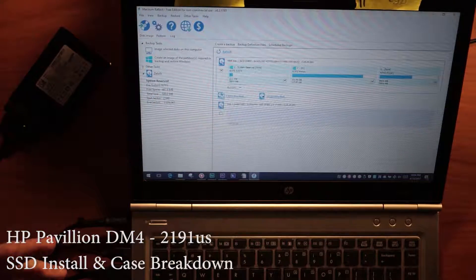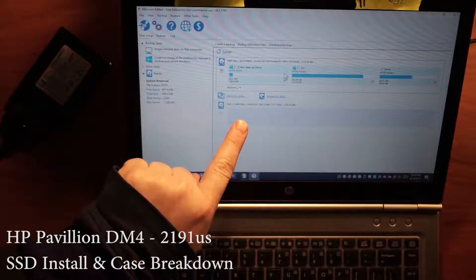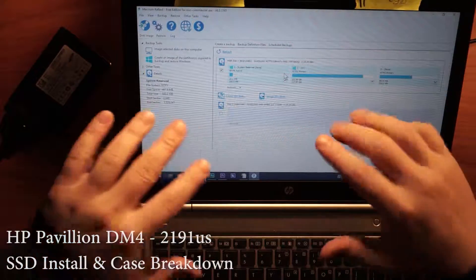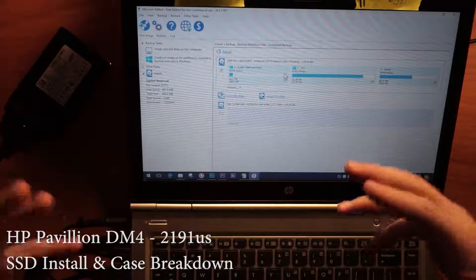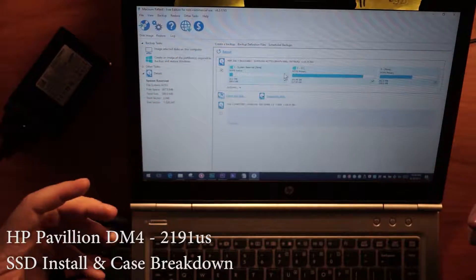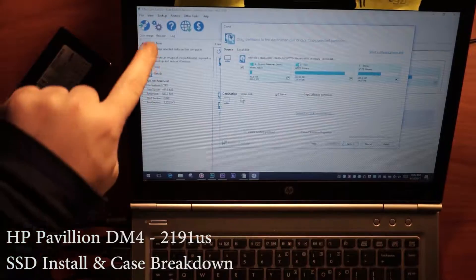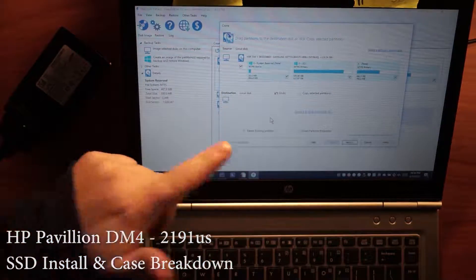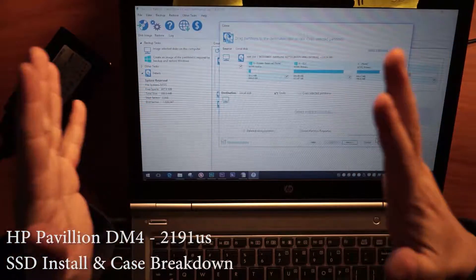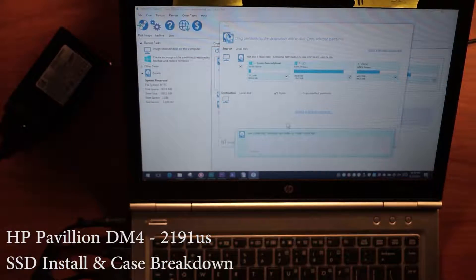No thank you to Rescue Media. That's the drive I want to clone — that's the drive over here. It's got no partitions on it. These are actually equal drives, so these two drives are identical. We don't have to tweak or mess around with anything. We're not going to run into any issues regarding one being bigger or smaller. But I believe there are some advanced settings somewhere where you can massage the partitions or maybe not copy all the data. So we want to clone it to that drive.